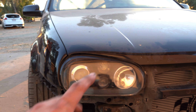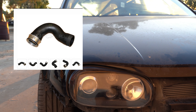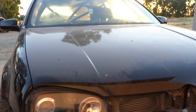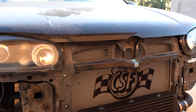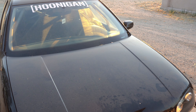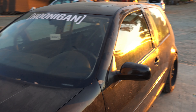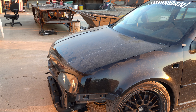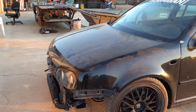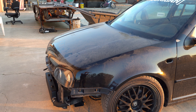Today we swapped out an intercooler — that wasn't it. We pulled the charge pipe off, and it's stupid how they made it — it has an O-ring on it and a clip, not a clamp, so I don't know how that doesn't leak. I'm sure that's about 50% of what it is. The other 50% was the wastegate — it was not adjusted properly, so it was cracking open way too early. I got that adjusted, but it still hits limp mode — it'll hit 15, almost 20 pounds of boost, cut, then go to limp mode at 5 psi.